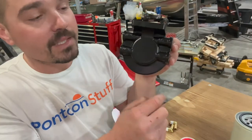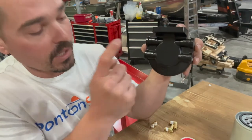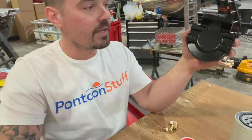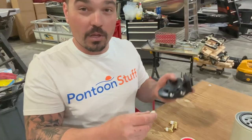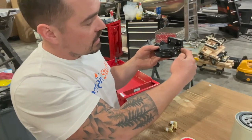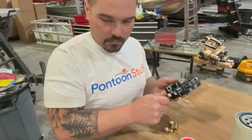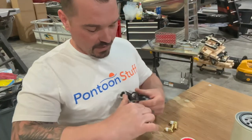We're going to have four fittings — two ins and two outs. I'm only going to use one incoming and one outgoing. Included in the kit, you're going to have these brass nuts — these are just plugs. I've gone ahead and put Teflon tape around just the top several threads, just a thin layer of it. I'm going to go ahead and plug these — a 9/16ths wrench or socket will fit this. I'll put them in so they're nice and snug. We're going to plug one incoming and one outgoing. The fuel line is going to come up and in, so I'll use this inlet, plug the other inlet and one outlet, because the line is going to go through and out the other side. I like to get them real snug — make sure no fuel is going to get out — but that Teflon tape is going to help as a barrier too.